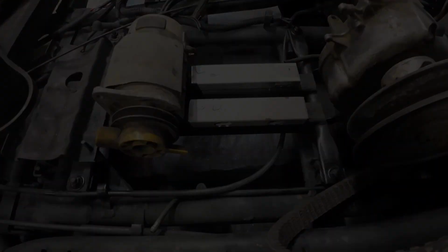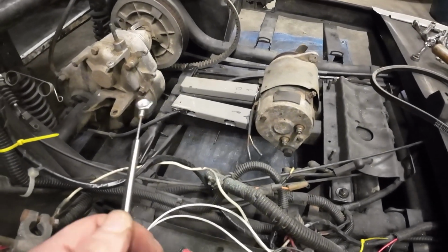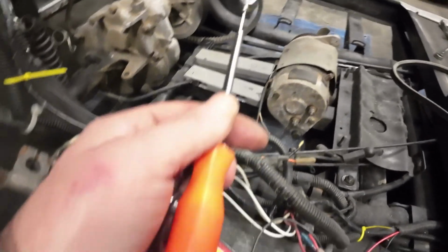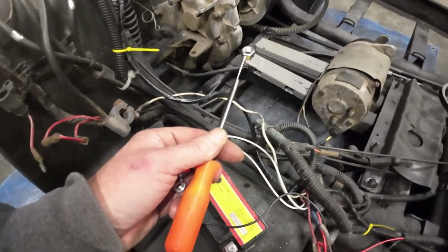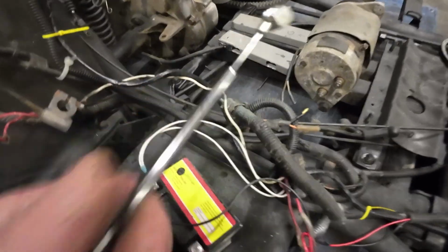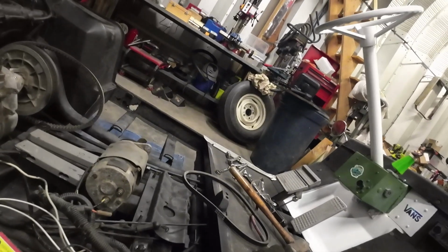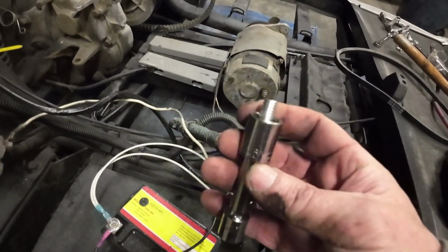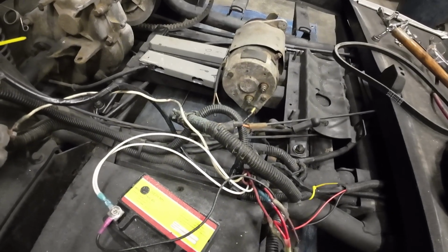and that will basically mount that motor in there for good. So for anybody who hasn't suffered through this type of access to bolts and nuts before, I use a very small, low powered magnet, you can see the tip is very small, and then use that to slide the nut in there. And then on the bolt side, just use a little small extension with a shallow socket, slide it up from the bottom. You're going to save yourself a ton of swearing and a ton of frustration.